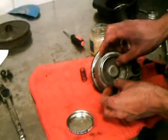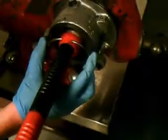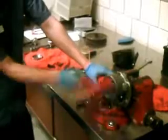And to hold it in there, we'll go ahead and take our retaining ring and put it on there. We'll put it in a vise to do this. Alright, so here it's going on. I'll just push in with the hammer like that to overcome the spring pressure and put the retaining ring in. I'm just giving that a couple of whacks to be sure that the retaining ring is seated, so the cap won't pop out.